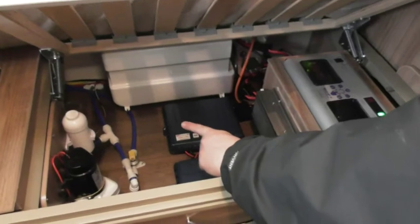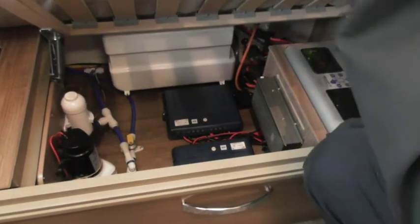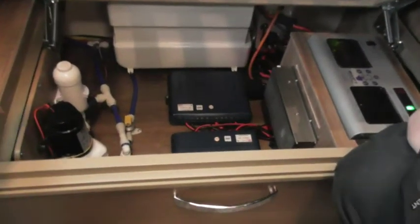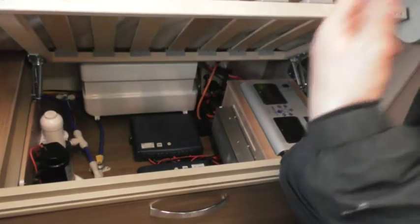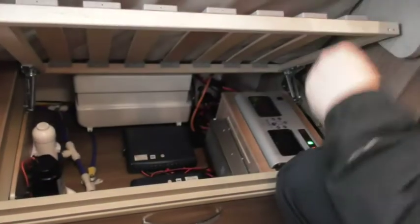and then the good old yellow drainage tap. To drain your system down, all you need to do is lift that yellow lever up in the air, leave your taps open in the central position, and it will literally drain all the contents of your water boiler and your pipe system. Do we need to do anything with these two? No, absolutely nothing. All you need to do to drain them down is just leave that yellow lever up. Don't close it back down, leave it open. Same as your taps, leave them open.